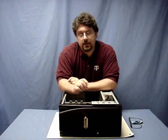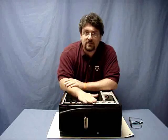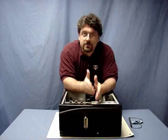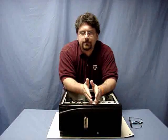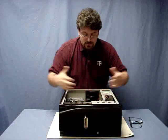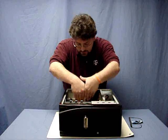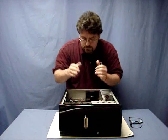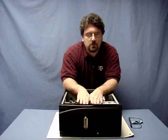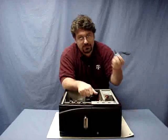What I typically do when working on a computer is rest my forearms against the case itself. As long as you're in constant contact with the metal frame of the computer, you should be okay. When I have my students work on computers, I always make sure that some part is in contact. If you reach in without contact, the first thing that's going to take that hit is whatever component you're working on. So rest your elbows and arms against the computer case — you'll stay equal with the case, you won't have any problems with ESD, and you can leave the strap in your case.